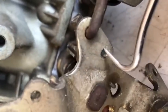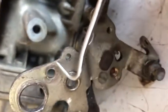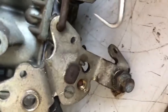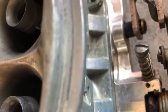So we just discovered another bonus to the Barry Grant. This hole here is where you would put the one-to-one linkage. On a standard Holley, that hole is too small and you have to drill it. But this one on the Barry Grant is already the larger size so we don't have to drill. And if you're using a standard Holley linkage apparently you have to cut this off here for clearance. Now it says you can run these on the outside or the inside, and it doesn't look like there's a lot of room on the inside, but we'll see how it goes.